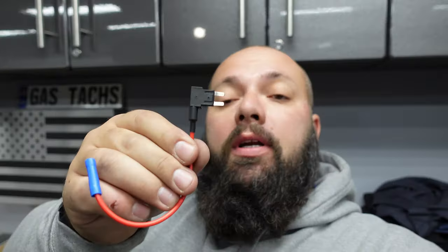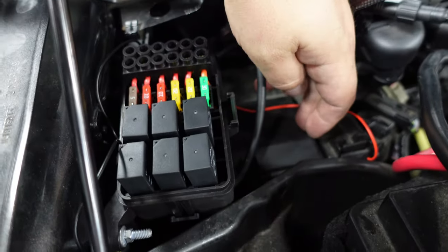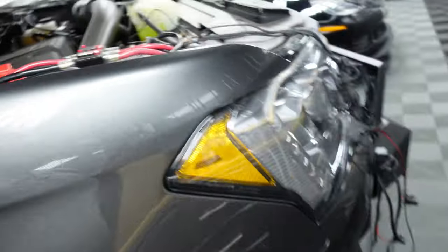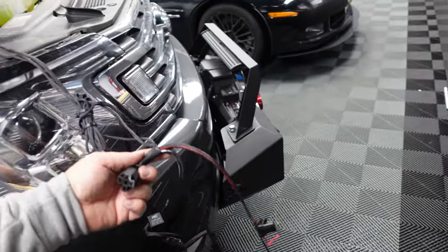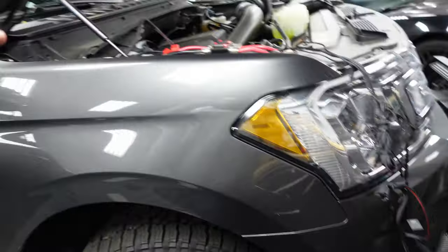Apparently Ford has tiny mini fuses and the fuse box tapper doesn't work with those. There is a fuse box right under here, so I just tapped into that fuse box since neither one had normal size fuses. Now this is working with the ignition. The first project is to make sure I can wire these lights — the front winch lights had their own relays and fuses, but now I believe I can delete all of that and hook them up to the new switch box. So I'm going to figure that out to make sure everything's working, and then we can start it up.